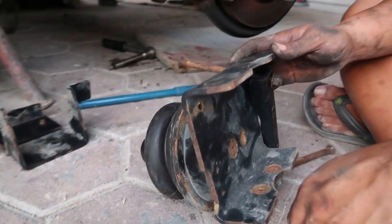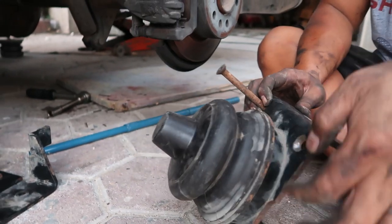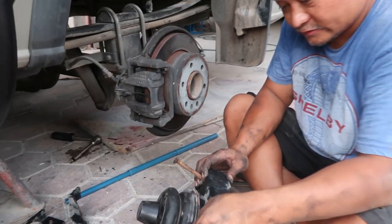We went on a lot of bad roads in Morocco, Africa, and Greece. We're almost up to our Service B, so about 40,000 miles — not a lot, but some are heavy miles. We don't know exactly when the crack happened — could it have been within the first week of installing the springs, or last year in Morocco? We installed everything right after we bought the van. We ended up having to find somebody in Croatia to help us weld the frame back up, which was pretty difficult.